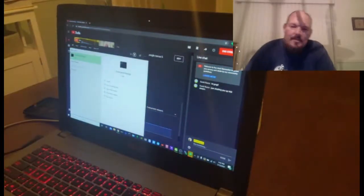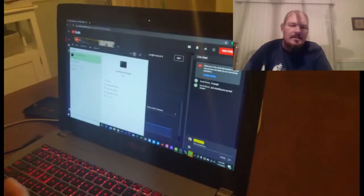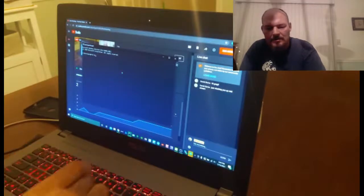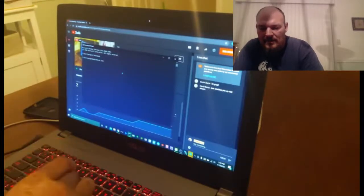I'll just let you guys know that bootloader unlock, if you want to know how to unlock the bootloader, there's plenty of videos online already. So you can Google it. It's pretty easy, but I'm just trying to save some time. So go over here, click on the app, and we'll type in CD downloads. And you gotta make sure you spell it correctly, if you can help it. Then CD Fastboot, because we gotta create the directory, and we gotta create the path.